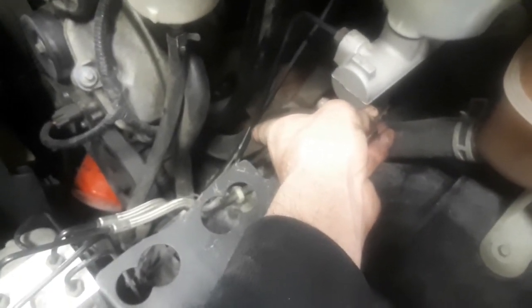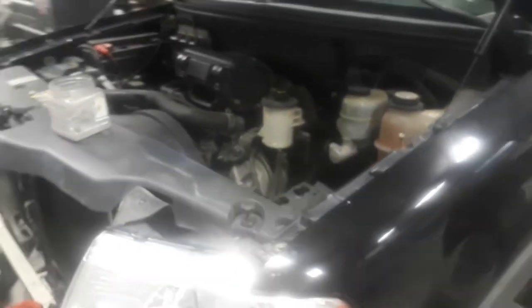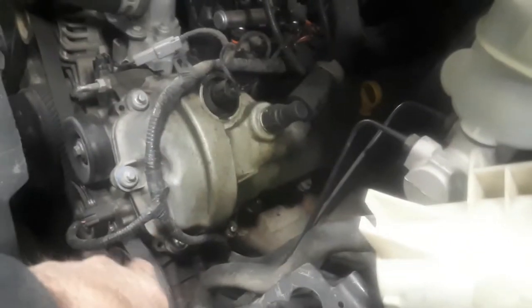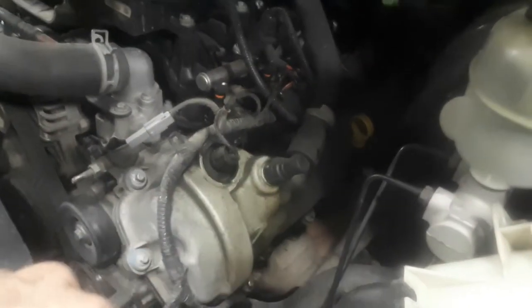We got it out of there. So you can see, just with the removal of the power steering pump reservoir, how much that opens up the access to the valve cover. But now we've still got to get rid of the PCV breather, disconnect our wiring, and remove all the coils along the top and get all that up out of our way so we can work on getting the valve cover unbolted. It's kind of dark back in there - real tough to see.